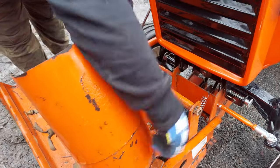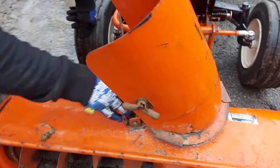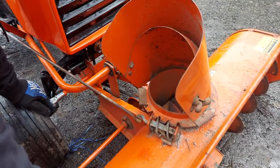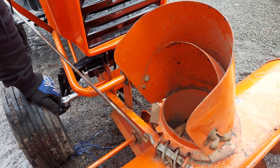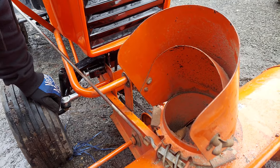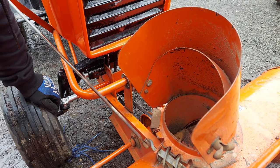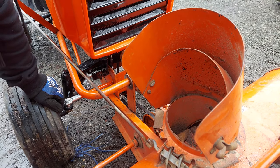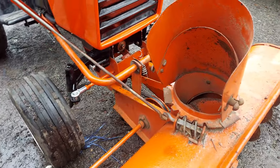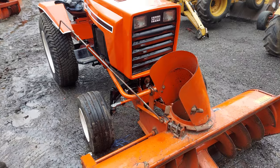We recommend putting some kind of lube on here and on this worm gear. The dry belts are Case IH OEM, important to be. They're 9/16 wide and made of a real good material. They last. The belts you're going to get at your local stores are going to be 1/2 inch or 5/8, and they won't fit in the pulleys correctly. They'll change the RPM and they don't last. They'll get you out of a bind, but you won't find 9/16 belts anywhere besides Case IH and maybe special order. So we stock those on our website.